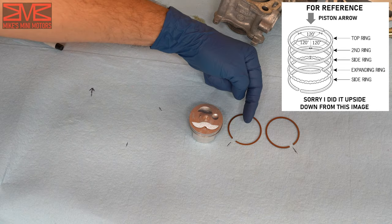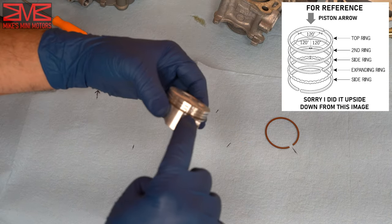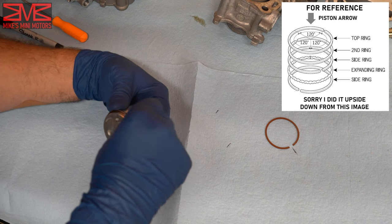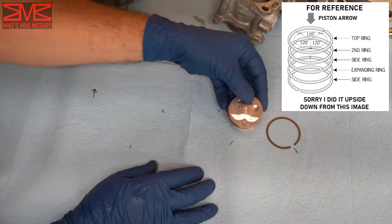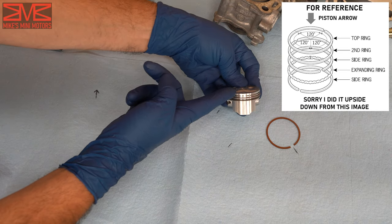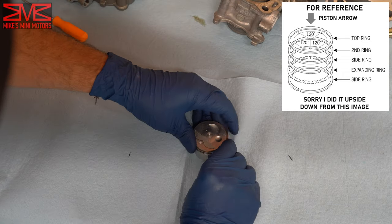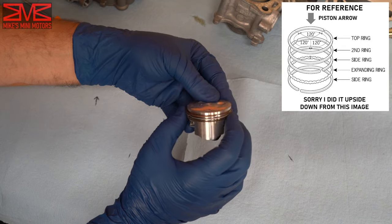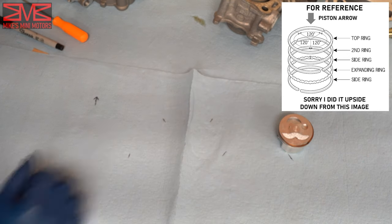Try not to scratch the piston itself and also don't overstretch your rings. Make sure the orientation is right: arrow up, opening here. Then the last piston ring goes in the top slot with its opening going the other way. These ones you can pretty easily move now to line them up. So just go through the pattern, check each ring and make sure the gap is where it should be, and as long as everything looks good we're ready to throw this on the engine.